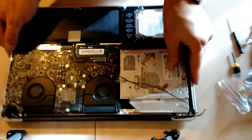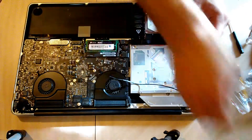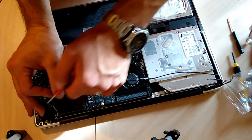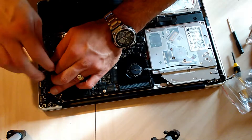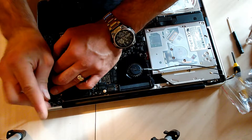Fold your laptop screen closed now that you've got all your screws tight in place, and set your laptop back down on the table so you can reassemble every connection, the clips, and the frame, to get everything back together. Now go ahead and put the middle hinge T8 screw on each side back in place and ensure that all six screws are tight.